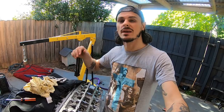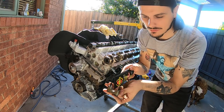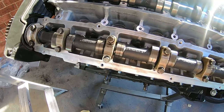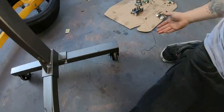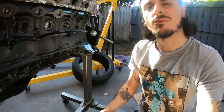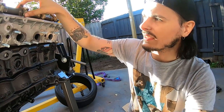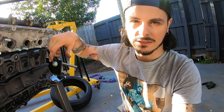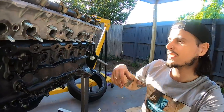Thanks to Penrite — get yourself some assembly lube and put a bit between the cap before you put it in, so it's all greased up and when you start your engine it runs nice and smooth. I didn't film putting the caps on because the engine lube went all over the floor — it was a nightmare. Anyway, got the cam gear on and the caps on the camshafts. See how they're loose right now? Put the camshafts in, put the caps on hand-tight for now, then put the timing cover on — this mark tells you the timing for the cam gear.